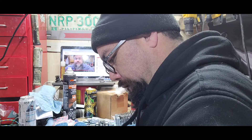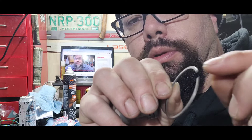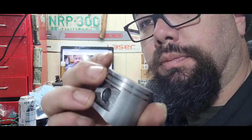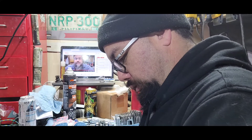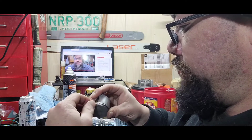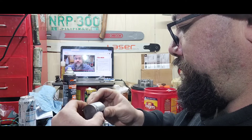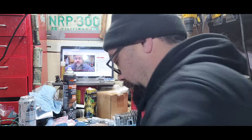If I'm going to do this right, do it right the first time. If you look at your rings, they have a taper on both ends. So you got to look at your piston — two rings, it has two little steel dowels in there on both sides. It doesn't matter what order the rings go on or which groove they go into; it's not specific. The same ring does top as the bottom. I have broke a ring before — brand new ring trying to get it in its place. There we go, boom, in. That's the bottom ring.